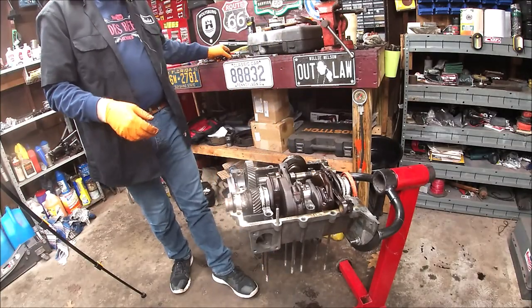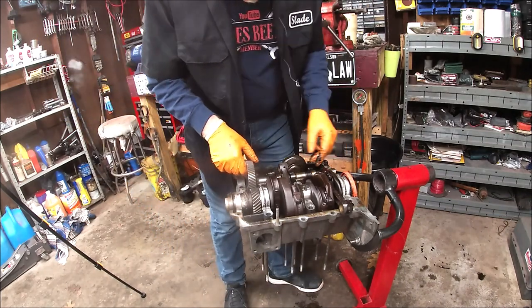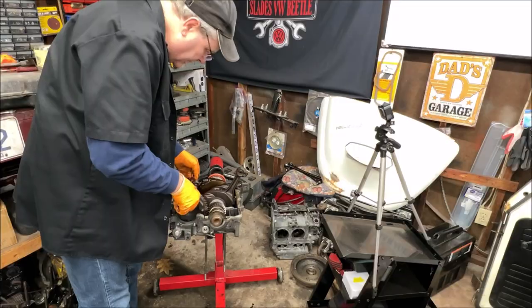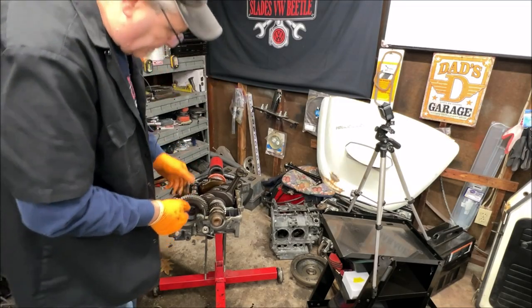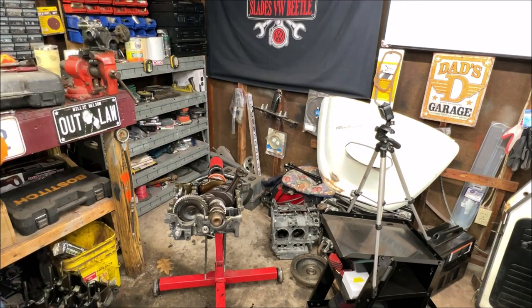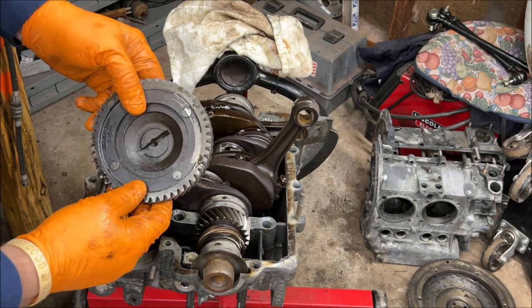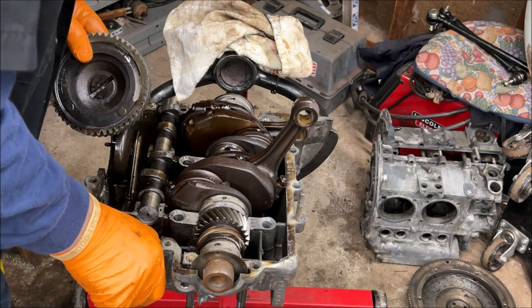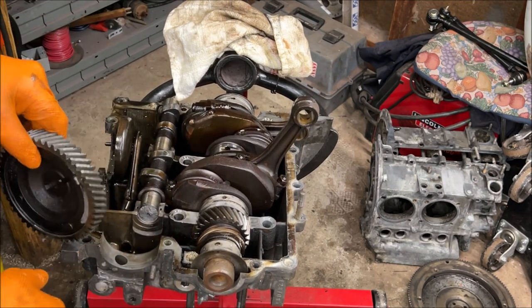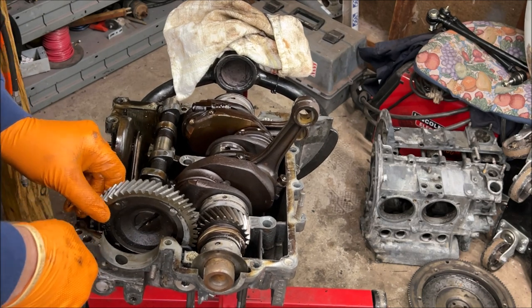One lifter made it to the floor, which is fine — I'm not using these parts over so it's not a big deal. And there's the broken cam. There's a new seal — see what happened here: this stud apparently was tightened in too far, it's what they told me happened, and it broke the cam gear.